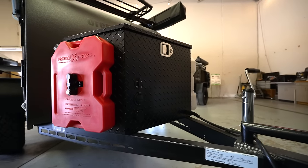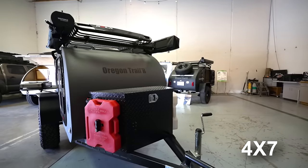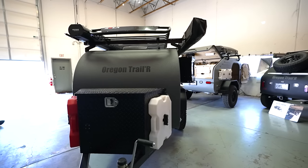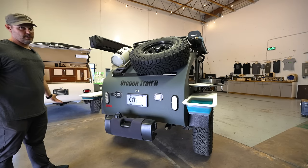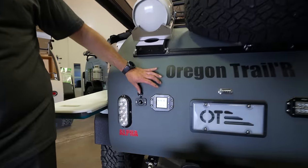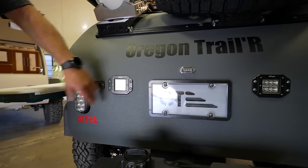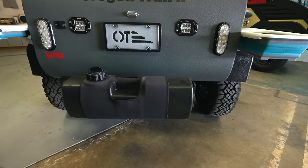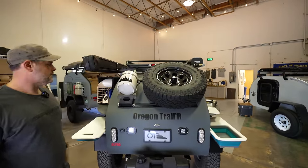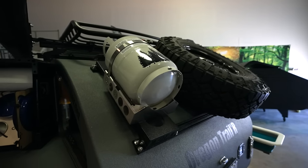It's extremely off-road capable, partly because it's narrow - a foot narrower than our larger trailers. This is what we call a four-by-seven trailer. The body itself is seven feet long with a six-foot-six interior bed length, four feet wide on the outside, 47-inch interior width. Very comfortable for one person; two people fit in nice and snug but we have many couples using them happily. This one has an exterior 12-volt socket so we can power a fridge out here. They come standard with backup lights, stop-turn-tail lights, and marker lights - everything you need for legal towing. This one also has a propane tank strapped to the back for a two-burner stove, and a matching spare tire across the back.